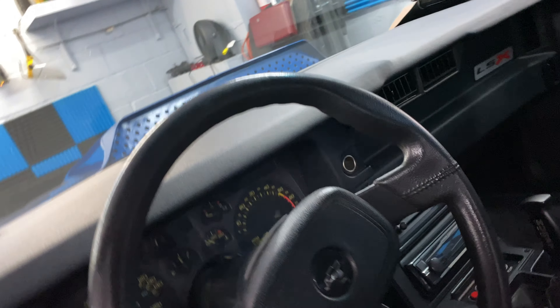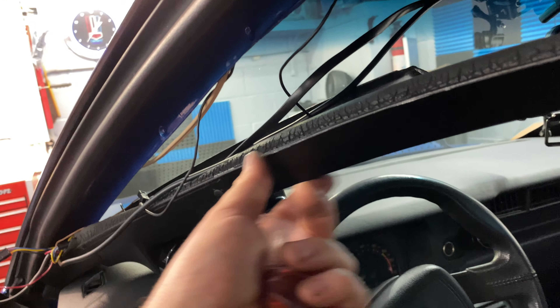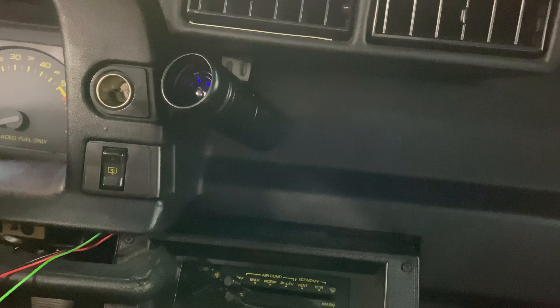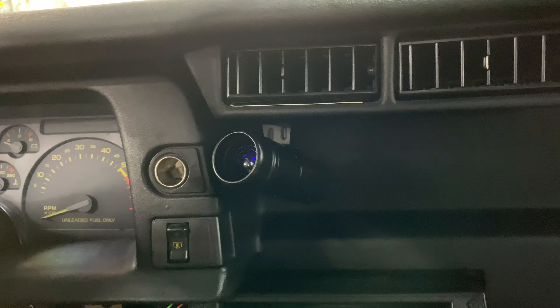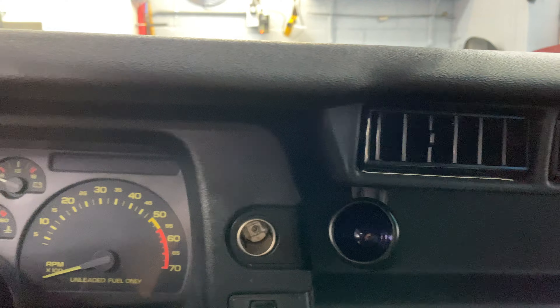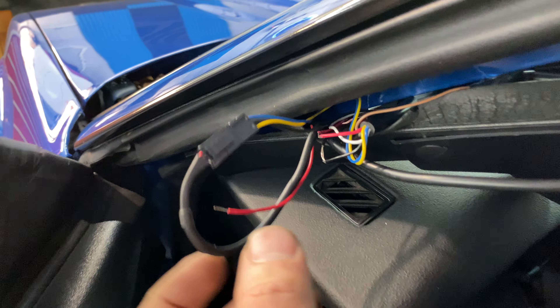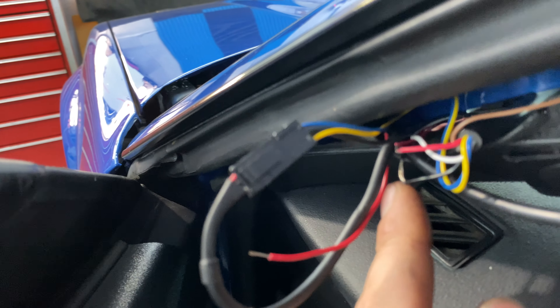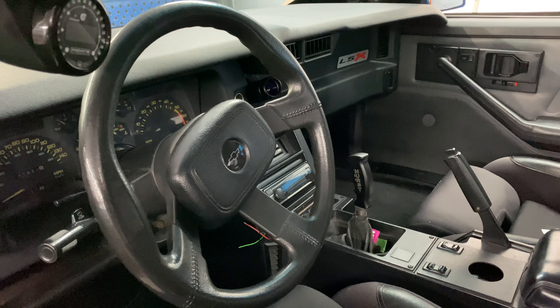I might mount it like this, or more likely underneath the vents. I got the light mounted up — I didn't put it up on the pillar because the angle was too off and it was pointing straight up in the air. I mounted it right underneath the vents; there was actually already a hole there, so I wonder if somebody had a shift light mounted there at one point. It comes with little self-tapping screws — I just put one screw in. I bent it and pointed it up and it's hidden away pretty nicely. The wires are wrapped in electrical tape and tucked under the trim, pretty much completely hidden. I'm going to run the wires underneath the panel under the cluster and tap into the tach wire from the non-working gauge, as well as the power and grounds — connect these three to those three and we'll be ready.